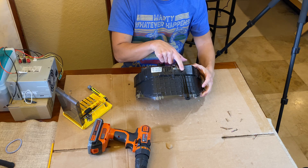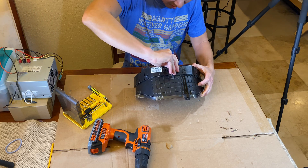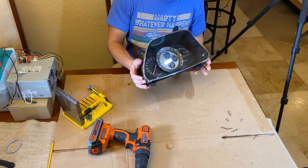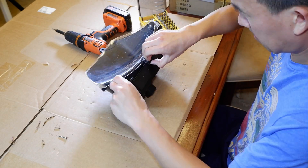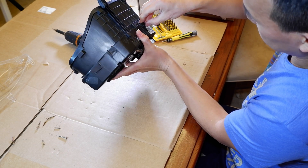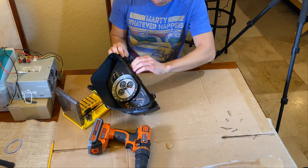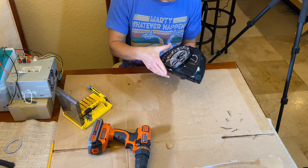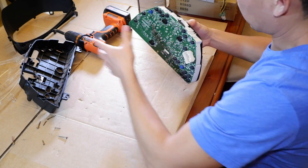Your cluster probably has a piece of tape over the top here - I already peeled this off because it was already peeling. You just pull off this little PCB board harness. Just wiggle it and pop it off and get it out of the way. This is the B plug harness that goes in here. After that, go ahead and pop the lens off and pop the front cover off so you don't damage anything. You can pop all these little clips by hand or use a small screwdriver or panel popper. Now we have basically the bare cluster. On the back side, you can pull the center part out - now you have the whole housing apart and all you have is the board.